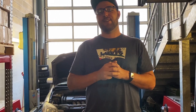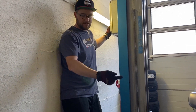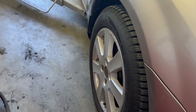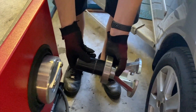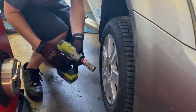Today I have a little assistant — her name is Aya, she's holding the camera, and she's half Japanese, my kid by the way. The first step is to lift up the front of the car to take the wheels off. As you can see, this is a front-wheel-drive car, so the wheels come off and the dyno hub goes on instead, allowing us to slide it into the pod to measure the power.